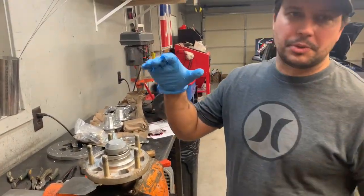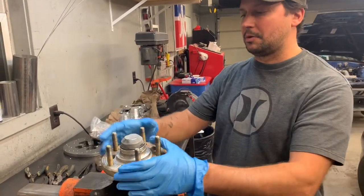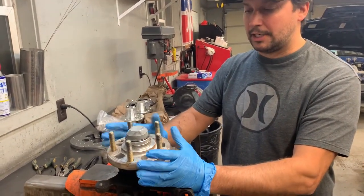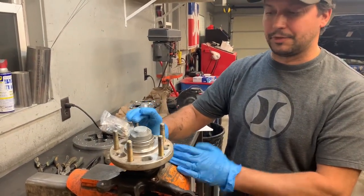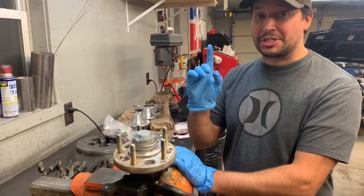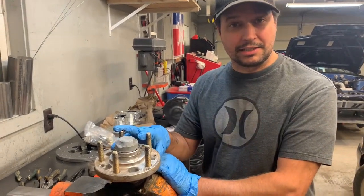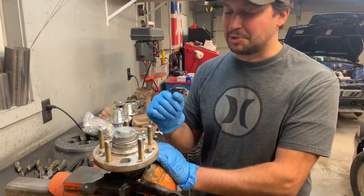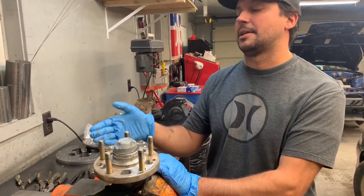So we got both the wheel hubs off. The instructions for the Aerospace basically just have you tear them down to the spindle. These are just OEM Mazda RX-7 front spindles and hubs. The only thing I did is put in bigger wheel studs to accommodate drag wheels because they have to be a certain protrusion for the stud — which is unfortunately different than the ones supplied in the Aerospace kit. So now I'm going to have to get new wheel lugs as well, which I wasn't planning on.